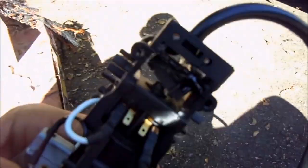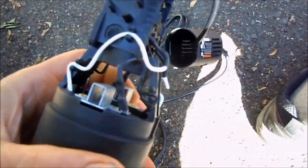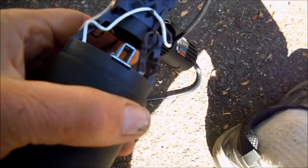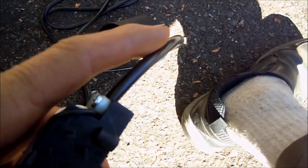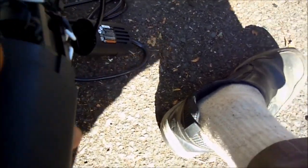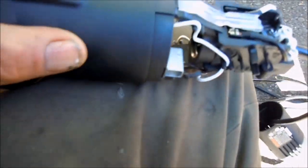What I've done is I glued a piece of plastic in there, so that switch is down there constantly — so it's a suicide switch. Basically as soon as you plug this thing in, it's going to be on. That's why I call it the suicide switch. The only hazard with this is basically don't try this at home — it's for informational purposes only. You could put an inline switch in the line; you can buy those switches at a hardware store. That would probably be the best thing to do. But for a quick fix, what I've done is just glued in a piece of plastic to push that little finger down so it's thinking that this switch is on.